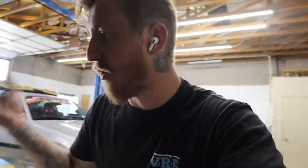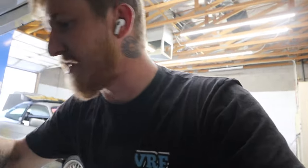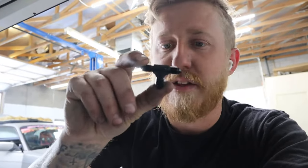Now that the bulkhead holes are drilled, we're gonna go ahead and start running the line. So the 68-inch one, I imagine, is the one that comes off the master cylinder, and we're gonna need one of the fittings to go off of that as well. So we're gonna take the banjo setup here, and we got our crush washers, just like that. We're gonna use those and run that back to the T, and then that will be where the back seat is, and we will bridge off of this.